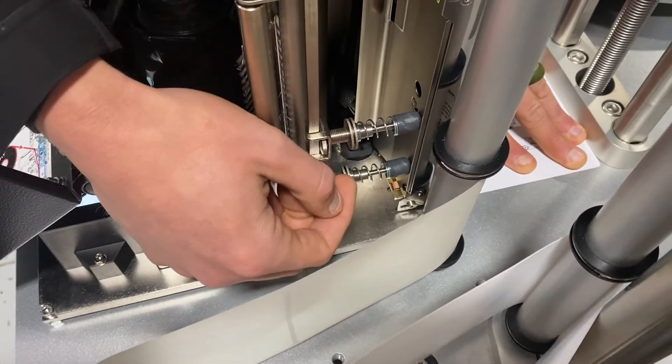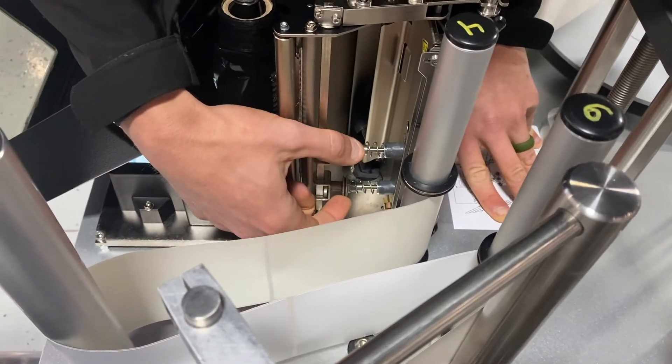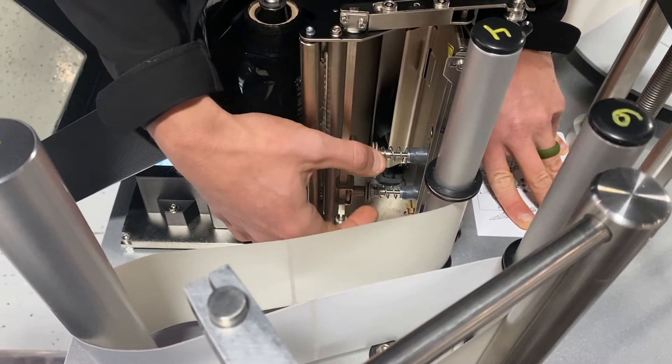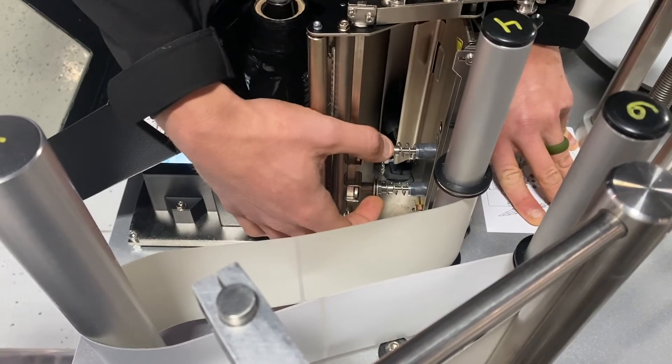I would always either decrease print speed or increase darkness before applying pressure to these toggle feet, but it's important to know they're there, what they're there for, and how much it can affect print quality and travel.